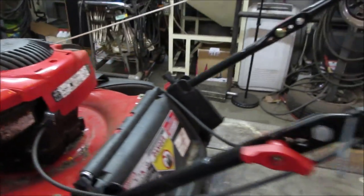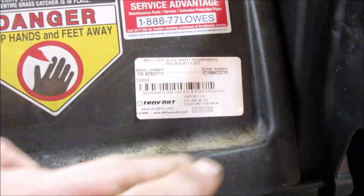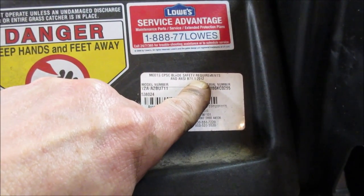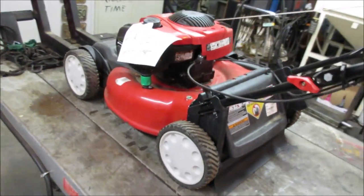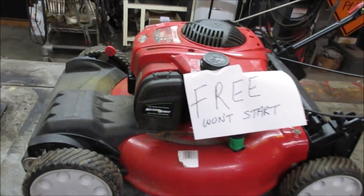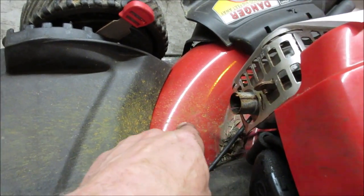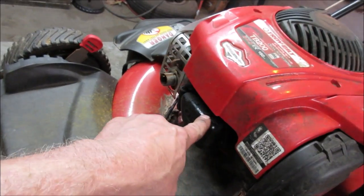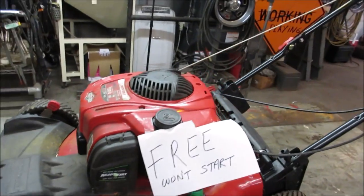I'm not sure what year it is. I think it's got a tag on the back — we got a date on it: 2012. It meets the safety standards for 2012, so we'll call it 10 years old. I haven't even tried pulling the cord on it yet. Let's give it a quick visual and see if anything looks a little funky. One thing I see right away is it looks like it was spitting rust out of the muffler. If it was left out in the rain I'm sure that didn't help. The valve cover's leaking some oil on it.